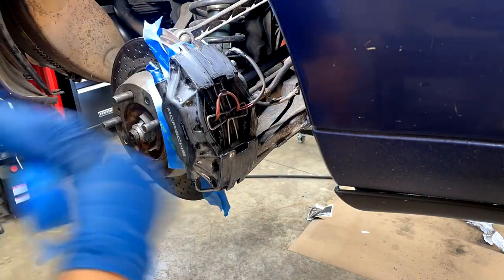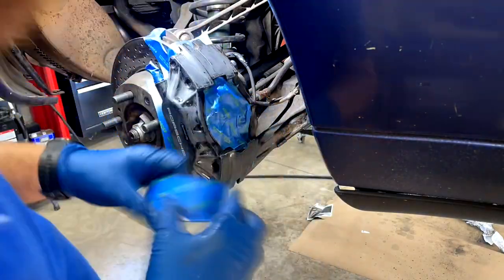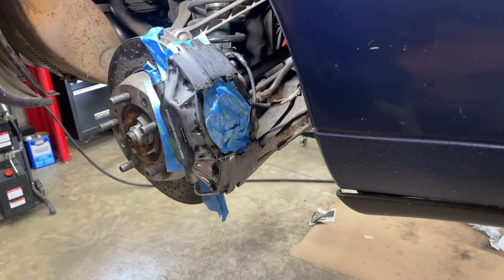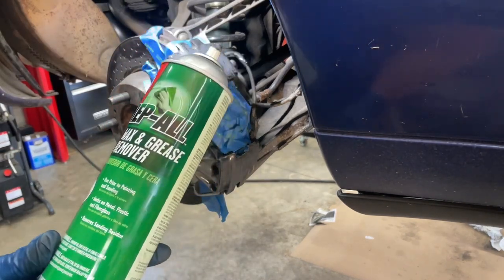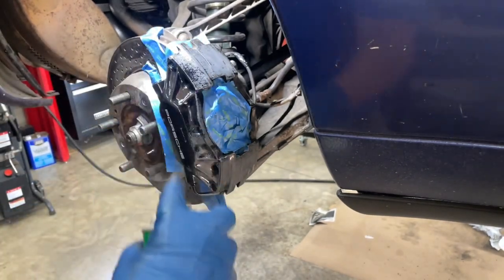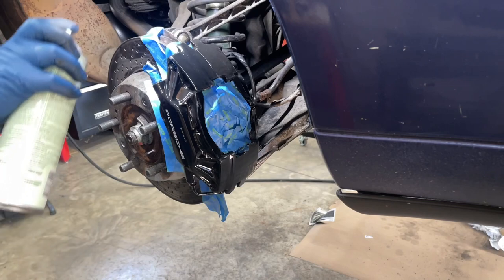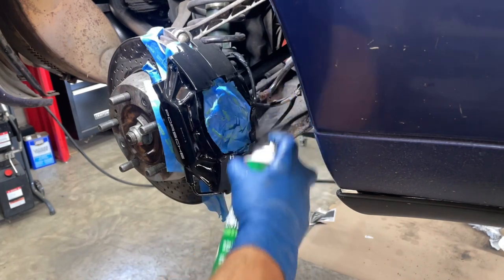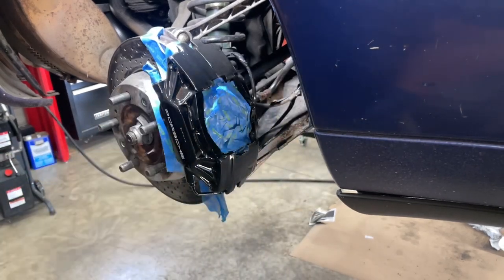There's nothing special to taping this off. I like to tape off the rotor to make sure I'm not getting paint on it. The G2 brush in the kit is actually pretty big. I just tape off the back — I don't want the pads getting anything on them. We've got the taping done. Is this perfect? No. However, now it's time for some cleanup. I've actually already wiped these down a few times, but before I get started I really like to give it a little extra. The brake cleaner is alcohol-based — it'll just dry up real quick and it's also a degreaser and a de-waxer, so anything on here will be cleaned off and ready for paint.